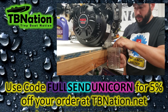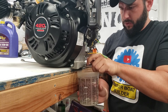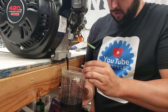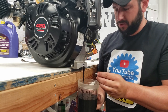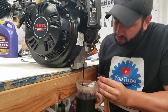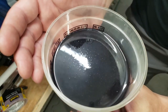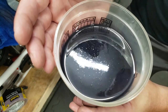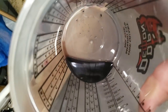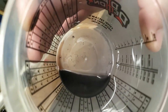This motor had fresh motor oil in it right after I rebuilt it — it was running Royal Purple, I think it was 10W30. We'll see what the oil looks like. It's got a funky smell to it, not what I'm used to smelling in motor oil — it's like a burnt kind of smell almost. It looks like there is some chunky stuff in there and some metallic bits. I just dumped all that oil and you can definitely see there are big chunky bits in there — and that was only the first half of the oil.